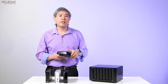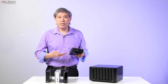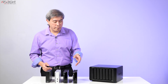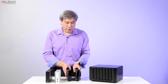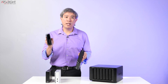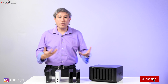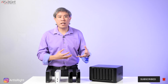Eight terabytes is a good amount to back up your data. If you want to go with a larger capacity — for example, 10 or 12 terabytes — these are starting to come up in larger capacities as well, however the price on the market is still fairly high. One thing I do recommend is to find two of them and get a redundancy set so that one can be an on-site backup and the other can be an off-site backup. You can rotate the on-site and off-site one every two weeks or every month, depending on how comfortable you feel.